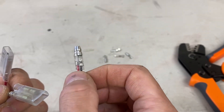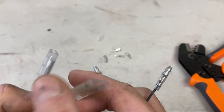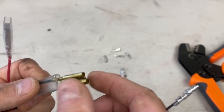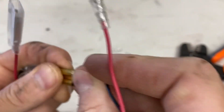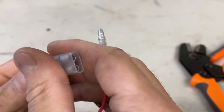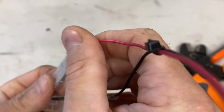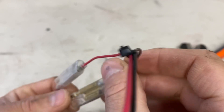Now when you plug it into your relay, you're going to have these little bullet connectors — bullet type — and you can order these from Amazon or get them anywhere. A lot of times when you order an electrical accessory it's going to come with these. On your relay harness itself you're going to have the female ends of the bullet connector. What I'll typically do is slide the sleeve down so you can access it, and these things will plug friction-fit into the connector. Just work them in — there it is. Do that to the positive side as well. Once they're seated, take the sleeve on the female component and slide it back over. Now everything is insulated and protected underneath the outer sleeve.